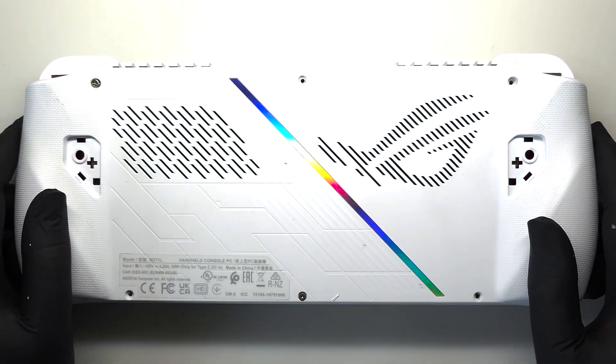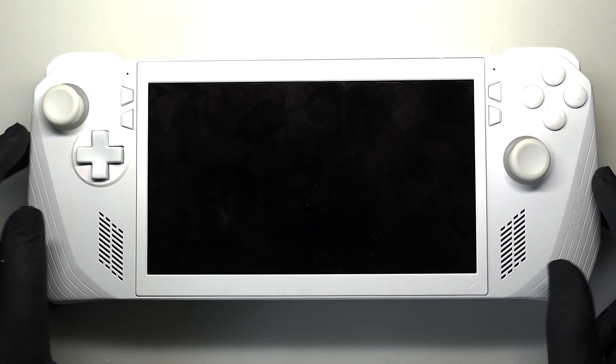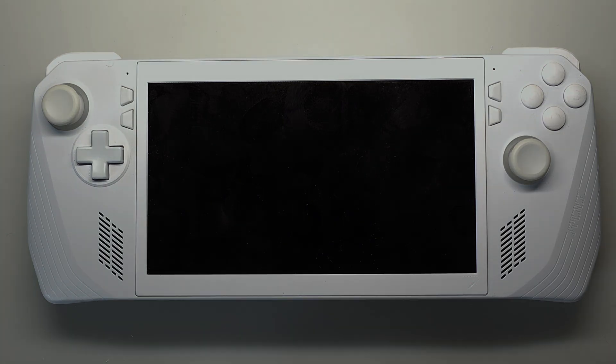The mod is now complete. I would highly recommend charging it up all the way and then discharging it to zero to calibrate it. Even so, there have been reports of these batteries degrading insanely fast or not reading the right charge level. Keep in mind we don't really know who is putting these together or where they're coming from, so there is always a chance your battery will be dead on arrival. Just keep an eye on it to make sure it's not swelling or anything weird is happening. Remember that installing this mod will void your warranty as we are cutting into the front shell.